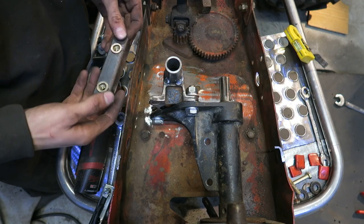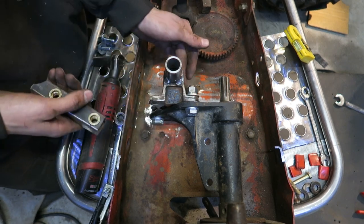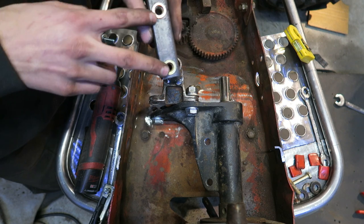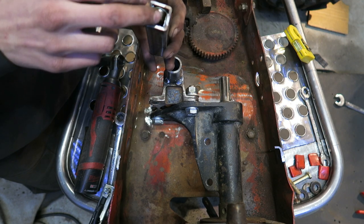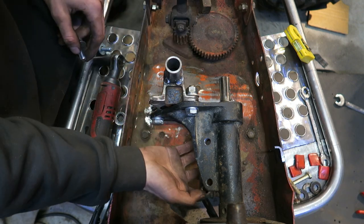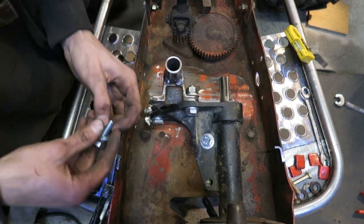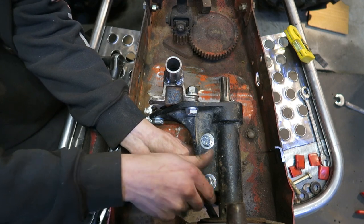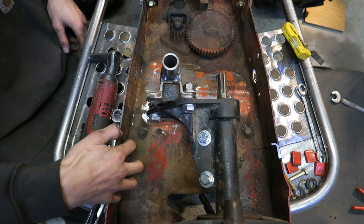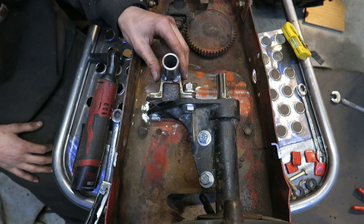So looking at it from the side — I made this little chunk of square tubing and this isn't going to be my only brace. I'm going to build off of here down to whatever tubing I build, but I made this piece with some M10 rivet nuts. If you don't know what a rivet nut gun is, it's basically just collapsible or pressable nuts — you drill a hole, press it in with your tool, clamp it, and boom, presses a nut in there just like that. This is going to get securely snugged in here with some M10 bolts. I drilled out the housing to hold M10s because they're nice and beefy, and I used M12s for the driveline stuff since you always want to be on the more beefy side. Now with my square tubing I'm going to run a tube or two under here to both sides of the frame, then weld it to this support so I can unbolt these two, unbolt this, and pull the whole assembly out.